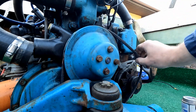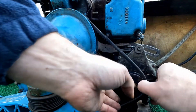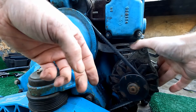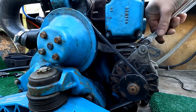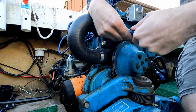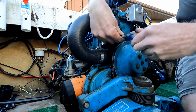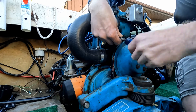That's snugged up. I'm going to put the belt on and then do the final tightening after the belt is secured. The alternator bracket is down where it needs to be, so I just have to get this on and tighten it up. There's a bolt back here to cinch everything up and keep it tight. And that water pump is installed.